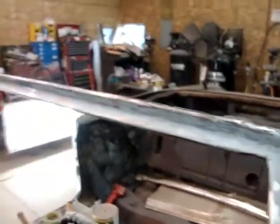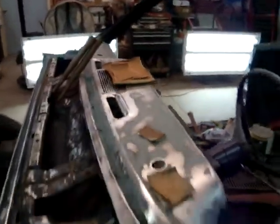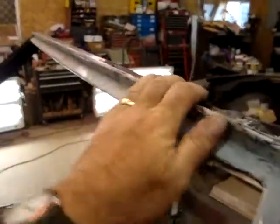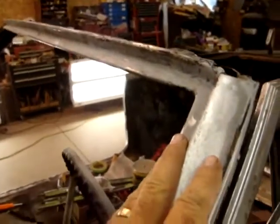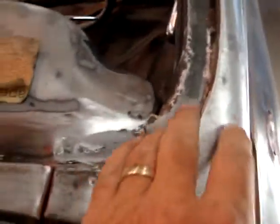A lot of times people will think that a convertible car can be done cheaper than a hardtop car. The price should be less. This is the kind of thing you always find. 90% or better, these headers leak on these convertibles. It may not leak on the interior in the earlier stages, but it leaks and it gets out inside of the posts. It gets all around these flanges. The windshield set down at the bottoms, always bad.